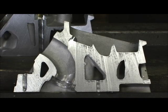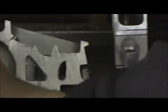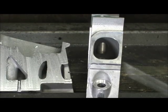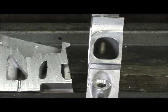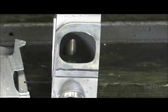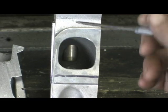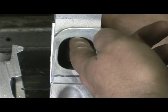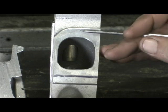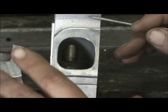up. It is, by the way, I don't know if I mentioned it, a D-shaped type port. It does look a little bit rectangular, but I promise you, it is a deceiving thing. It's more of a D-shaped type cut, but I got plenty of room. I could probably go about 125 right here. I have no fears of water jackets.